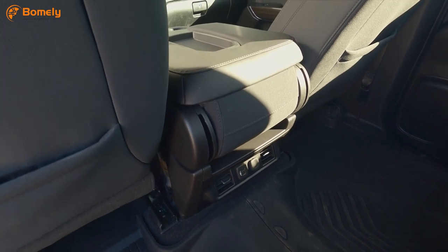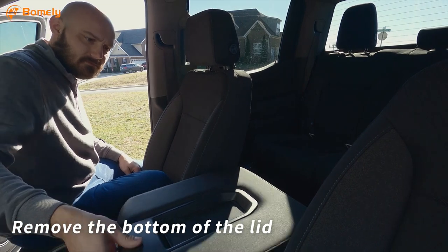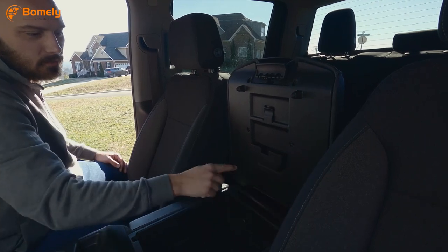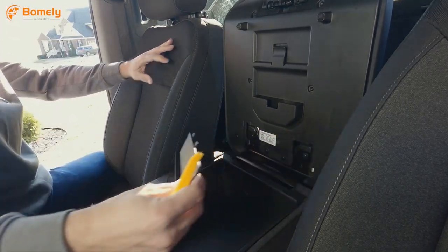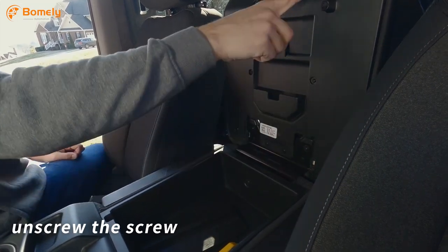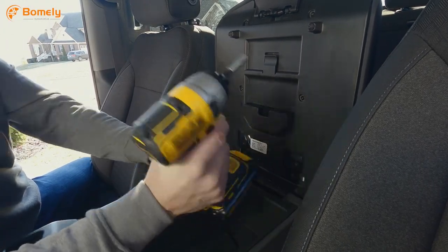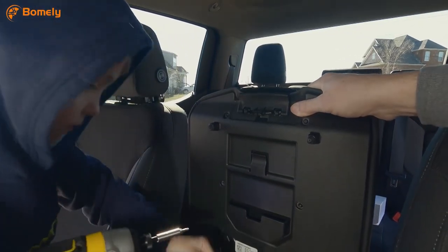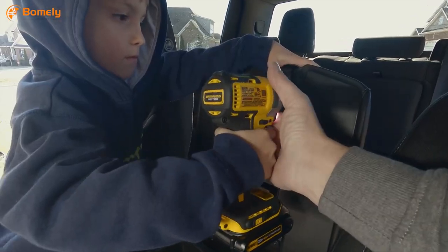Let's get started with the easy part, which is the top cover or lid to the center console. We need to remove the bottom of the lid, which is attached with several screws. There are also two screws under this cover, which is a bit of a hassle to take off and requires a considerable amount of prying. One thing to point out is that my truck is equipped with a center seat underneath the console, which requires purchasing a different charger kit, as the part being replaced is different from the five-seater trucks.